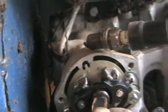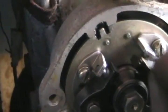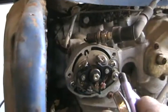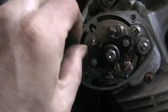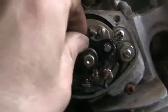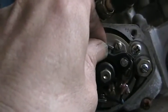Never touch the part of the sandpaper that makes contact with the points. Now the other side. Give them a blow while they're in open position. Then you rotate the engine until they're in closed position, and you grab the points arm. It always moves back and forth a little bit in any engine — you move it back and forth while pushing the points even more closed, rubbing them together so it makes a good contact. Rub them. They're only moving less than a millimeter, but I can feel the texture.